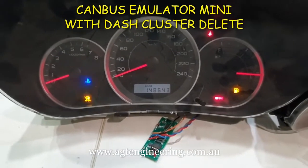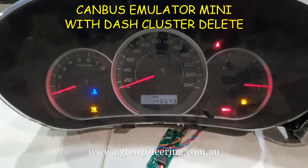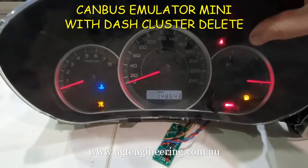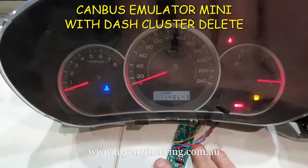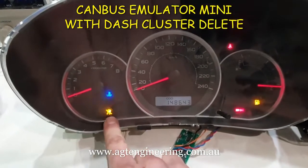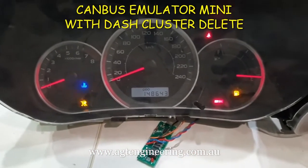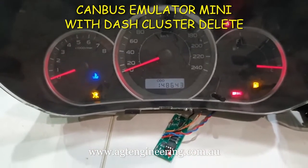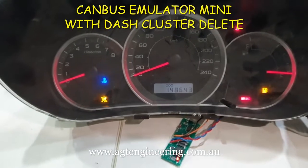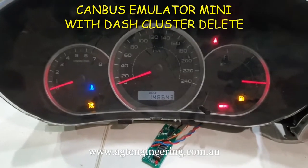At the moment it's capturing the codes, and this is not a quick process. Depending on the model, some take about two hours, some take up to about four hours. It's basically capturing all the codes out of the cluster and storing them in the emulator. You can see the SCID lamp is flashing, which means it's working and copying the codes. It's also got a little indicator light that tells you what it's doing — whether it's capturing codes or actually emulating the cluster — so that can be used for fault finding.